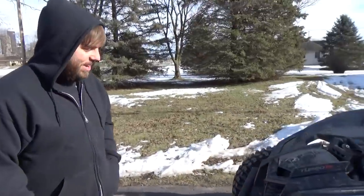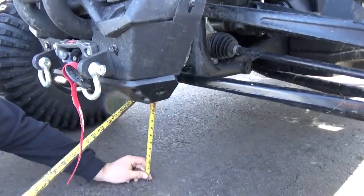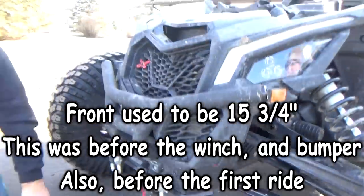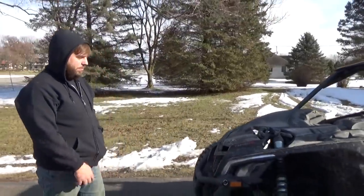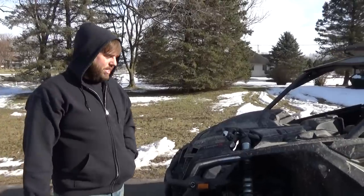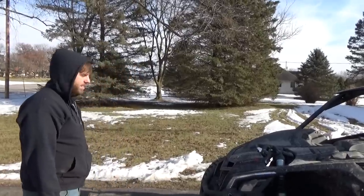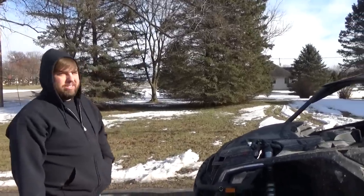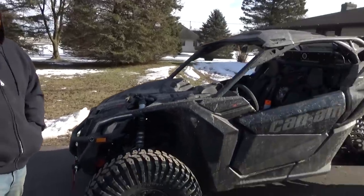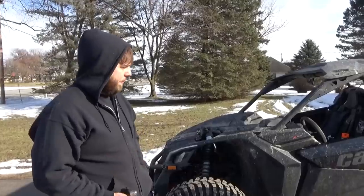This chassis rib is 13 and a half — that doesn't seem right compared to before. But we added quite a bit of stuff to this thing: the front bumper, sound bar, cooler, storage, exhaust. Quite a bit of stuff. We're going to pull it back in the garage, get it raised up a good bit, and let you know what we end up at for our finished ride height. I'm thinking like two inches. Could go up a lot — I've seen quite a few raised up quite a bit higher and they looked good. That's mostly what we're after is ground clearance for what we do.